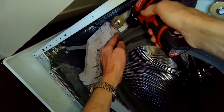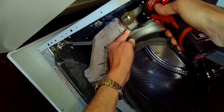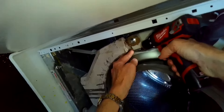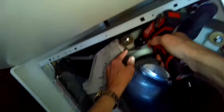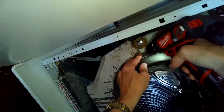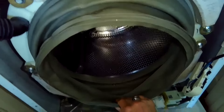Now put the ring back on. We're going to tighten that up with the Phillips head screwdriver — this is the one that holds the door gasket onto the tub. You want to get this pretty tight. Go with your Phillips head screwdriver basically until it's giving you a lot of resistance. We got that on strong; we don't want that to come off later, because then you'd have to do the whole disassembly again. Tug on it a little bit to make sure it's not going to come off.